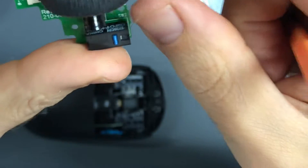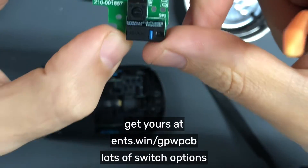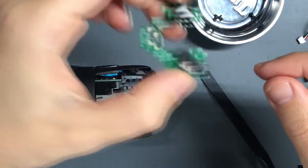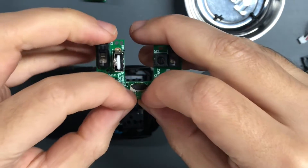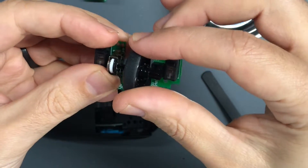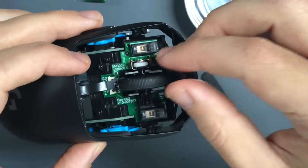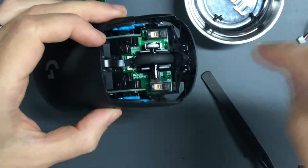So this is the piece that, once you take the scroll wheel out, I'm selling with replaced switches. You could take this, put it aside, and then take your modded piece, open this clip up here, and then put your scroll wheel in. Put this back in here, put this in, slide in the ribbon cable, do those four screws, the piece of plastic, and those two screws.